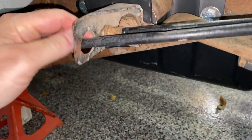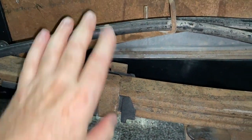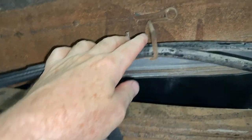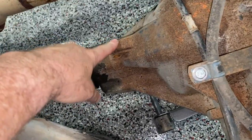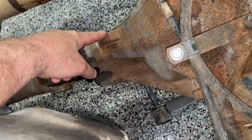Now that I've got the bracket taken care of, you can see it's bolting in place. I've got both cables going in the holes correctly. Be sure to route these cables correctly to begin with — I had to undo some things and redo them. There's a bracket right here that mounts to the frame, and we have both cables through it. This one goes to the caliper with a little cable stop, and it works just fine.